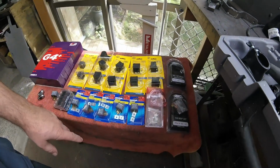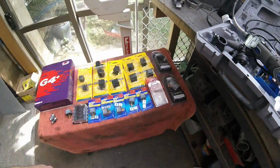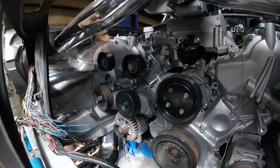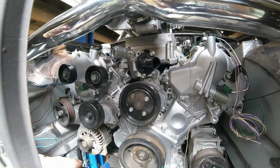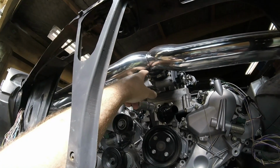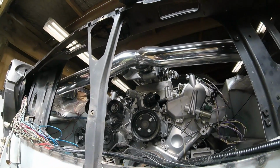And there's also a Link ECU inlet air temperature sensor. So we've already got one in the manifold. You might be able to see that. Let me know if you can't. That's too bad. Just above the thermostat there, there's a sensor in the inlet manifold. That's post intercooler, and we'll chuck another one in here somewhere. It could actually be either side, wouldn't matter. Probably better to put it in the middle just in case one side's getting hotter air than the other side.